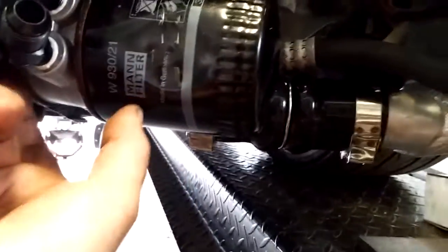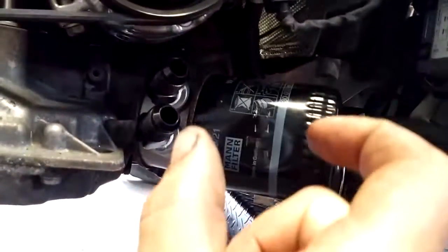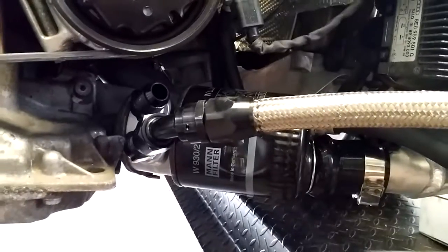Oil cooler. I have removed the stock liquid-to-liquid cooler, and I'm using the stock B7 RS4 cooler. Sandwich plate in here. I removed the original 3/4-16 stud that was in here for the oil filter that was much longer to accommodate the stock cooler. So I just bought a little 1.5-inch long one there. That goes on there. We've got our AN fittings, and these will go right through a nice opening in the rad support of the B7 RS4.